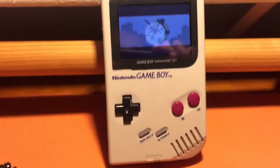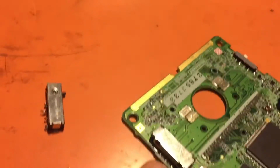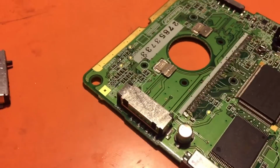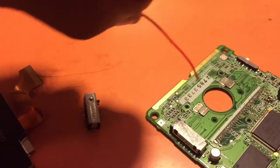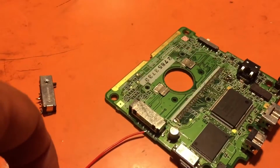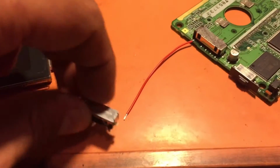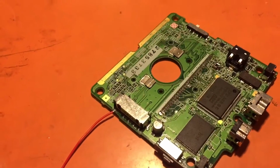And it works perfectly. So don't forget about that, because you are going to need to desolder those 4 points, pull that bad boy off, and then once again maybe double the length of this wire right here to fit it across to the other side when you're finished with this mod. And once again, it's just plug and play, so point 1 to point 1, and so on and so forth. So that's how you do that.